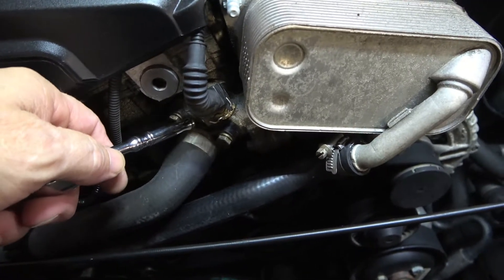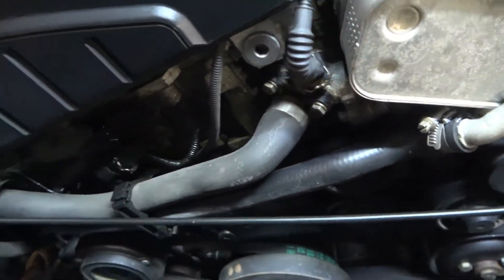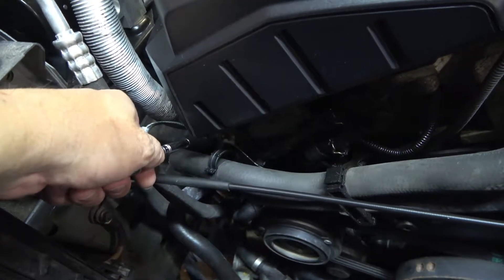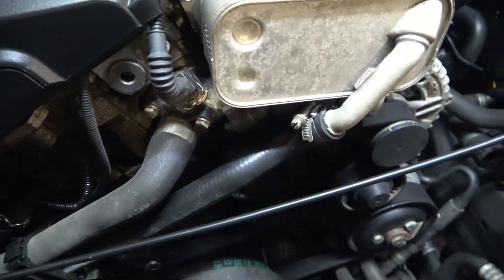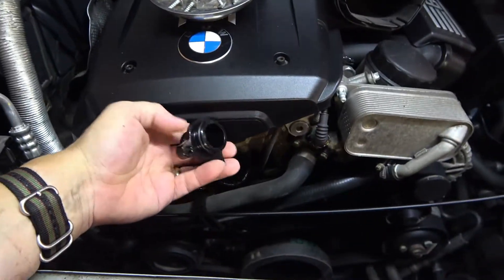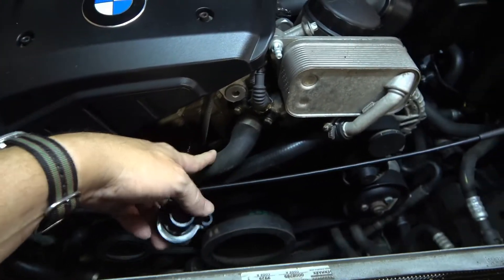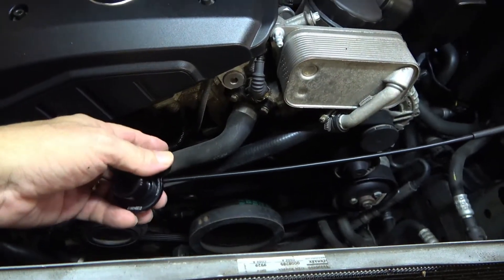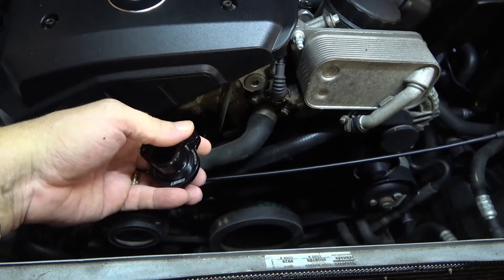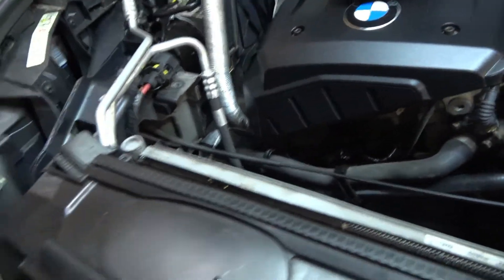All N52 engines are equipped this way. This is an outflow from the cylinder head, and it goes all the way down and into one of the input lines for the electric water pump. So we get a replacement billet aluminum fitting from ECS Tuning — I'll put a link in the description. This comes as a kit: the fitting and a new custom molded silicone line specific to whichever motor or install. They're pretty much all the same, but there may be some routing differences between whether it's in an X5 or a 3-series or 5-series.